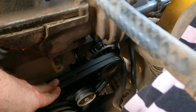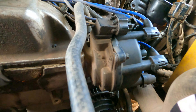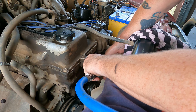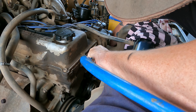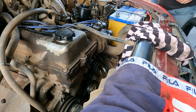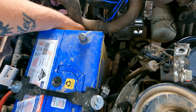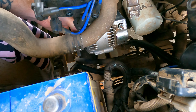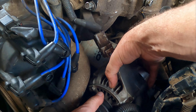She's just cracked. I'll take the bottom bolt all the way out — bottom bolt's out, everything's very loose. Get these belts off; you can probably leave them sitting there rather than take them right out and get fiddled up with the fan. Now we can get the top bolt right out — it's already pretty loose. She's a pretty awkward thing to get in and out; I've got to come around to the other side of the vehicle. It's awkward — you can't even get your hand in under there. I'll pull the top bolt out and thread it through this gap. Here it is.